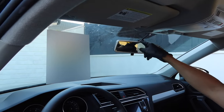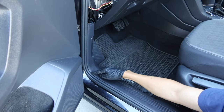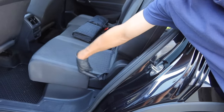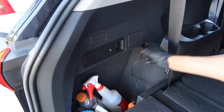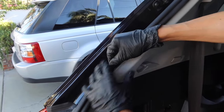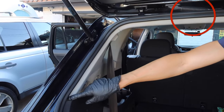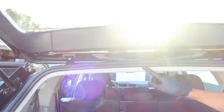Here he's showing where he passed the wires for the rear camera — along the step into the back. Of course this is all under the plastic panels. From the back seat into the trunk, and from the trunk close to the lights and then up. Once into the top of the car, we use plastic pipes to go into the plastic surrounding the rear window, and then it comes out to the camera.